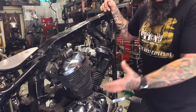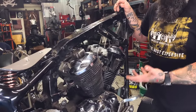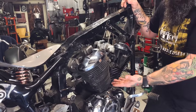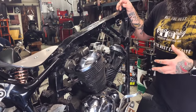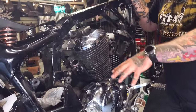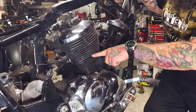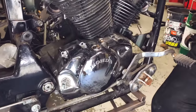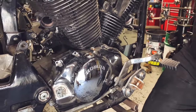That pressure has to go somewhere. It can't just be pushed in there all the time over thousands of RPMs and just be fine. If you don't have a way for that pressure to vent and then have a little bit of pressure drawn back in when the piston comes back up to the cylinder, you will end up pushing oil and air out of the weakest point in your bike. You've got gaskets and seals all over this bike — here, here, here, up here, down the center of your motor. They're all over the place. You even have seals on your pistons — that's the piston rings.